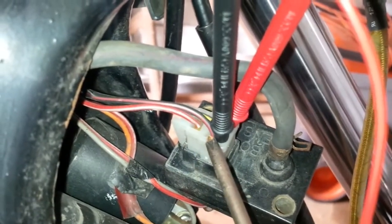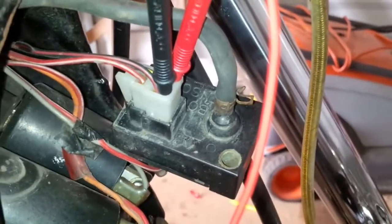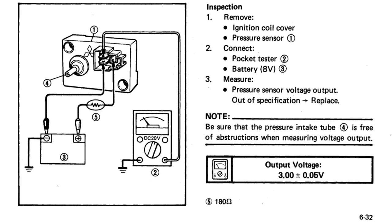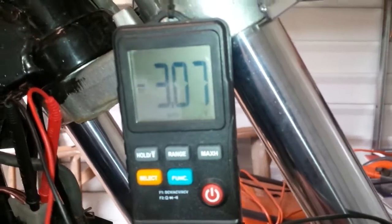The red and white wire is the 12-volt feed. There's a black with red tracer, and another black with yellow tracer — those are the signal lines that end up in the TCI. The vacuum port is also visible here. According to the manual, when there is no vacuum whatsoever it should read three volts on the multimeter — that's the resting voltage. And there we go: 3.07, which is close enough. If I fire the bike up, that number is going to drop.